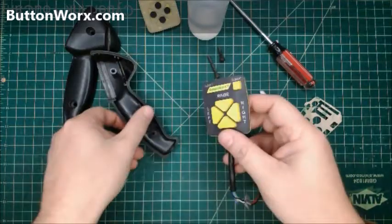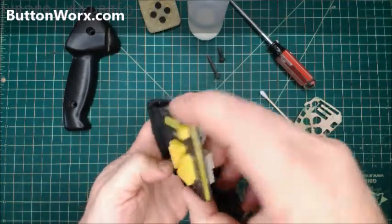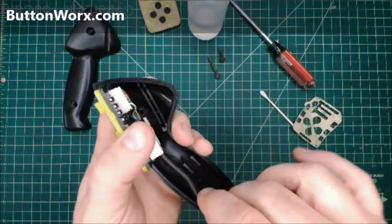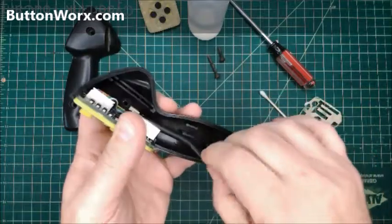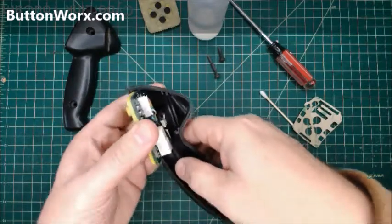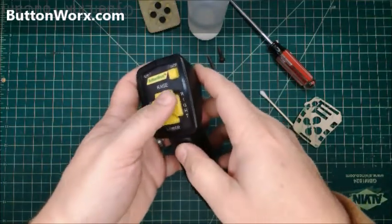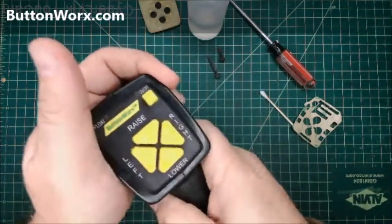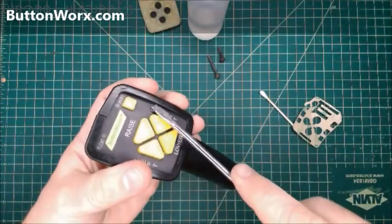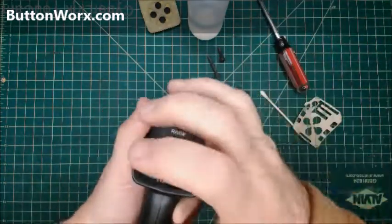The only tricky part — and this goes with any replacement keypad, even putting the same keypad back in — is making sure the keypad and the board sit in the groove. Then you put your wires back in that slot; they go through there and then through there normally. When putting the other side back on, it's harder to get everything in the slots. Sometimes it catches on the edge and you'll need to take the screwdriver and help the label part go in, or it got squished and bubbles up.